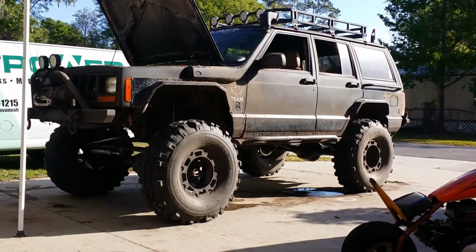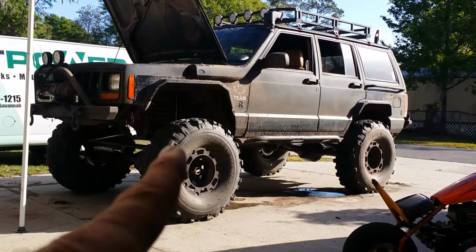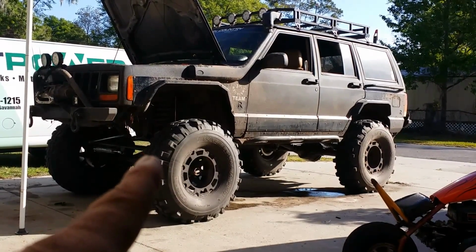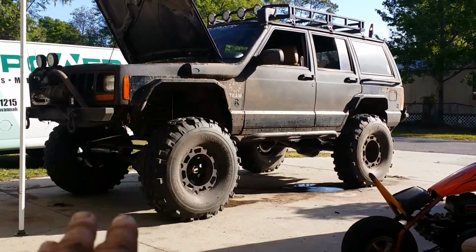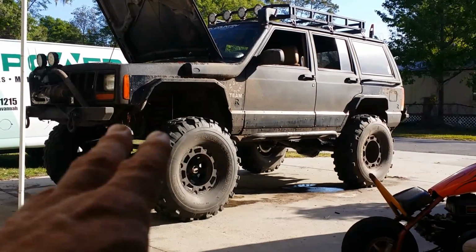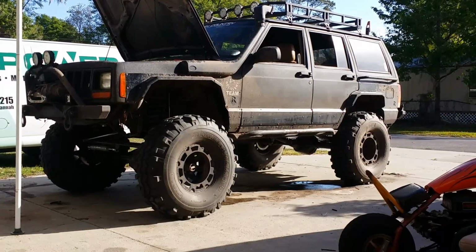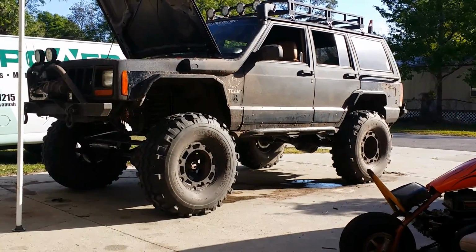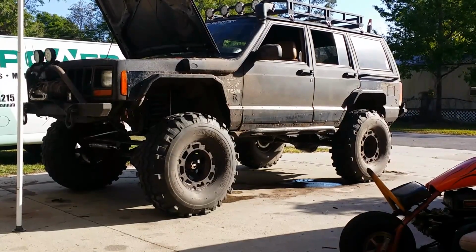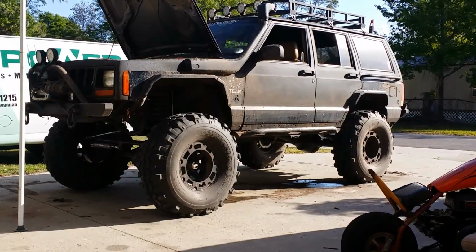It'll live at that. You don't want to sit there with it on the floor, but if you've ever tried to blow an engine up like that, over revving it, it ain't easy to do. It'll catch on fire before it blows up. If you just put a brick on the floorboard and let that thing scream into the rev limiter, it would literally catch on fire before it blew up. So the rod ratio in them engines is pretty good if it's a 4.0 and it ain't a stroker motor. Now you take a stroker motor and you turn it like that, and it's liable to come apart on you.